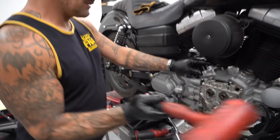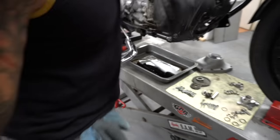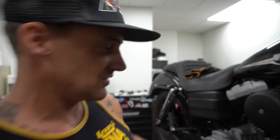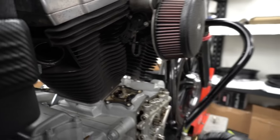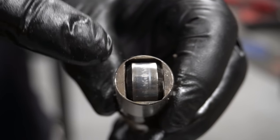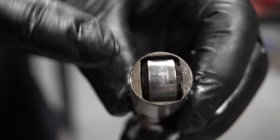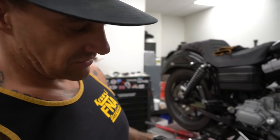Back to the tappet blocks — got to bang them off, they are baked on. Throw the gasket and O-rings straight in the trash. It goes in the trash so later on when you're putting the motor back together and you see an O-ring laying there, you don't go 'did I not put that in the motor?' Because you have to tear it back apart to find out. There is no 'probably' in motor building — there either is or there isn't, and you have to know. Here are our old lifters — they're definitely on the cooked side of things.